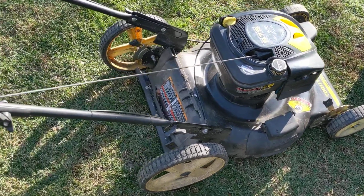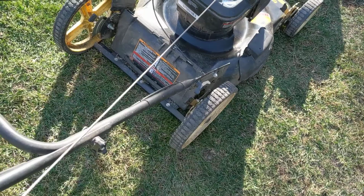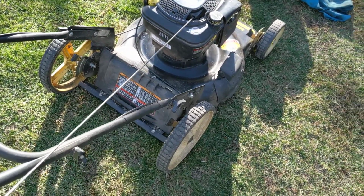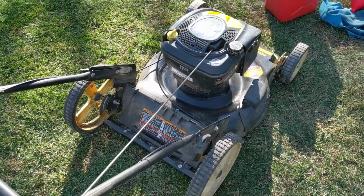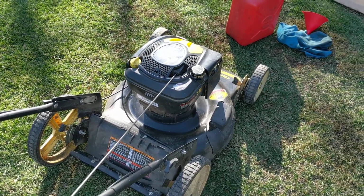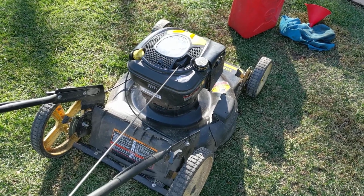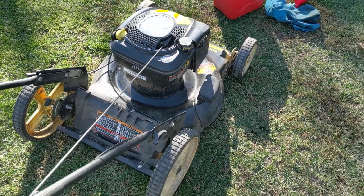So they've put this brake on the flywheel so that if you try and spin the blade around underneath, it's heavy and hard and you can barely spin it. It's supposed to hold it tight and it won't start accidentally.